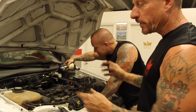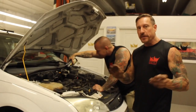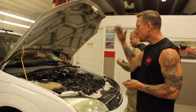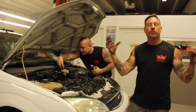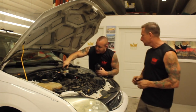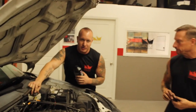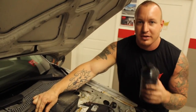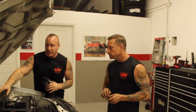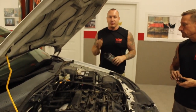Now that we've got everything assembled on the front drive axles — the brakes, the calipers, the new hoses — the next step is to bleed your brake system. What we did is we opened the brake bleeders on the back of the calipers and did what we call a gravity bleed. This simply means that brake fluid from the brake fluid reservoir ran down through the calipers and preliminarily set them up to make the bleeding process a little easier. Since we did open up the lines on this hydraulic brake system, we naturally lose fluid from it — also the loss of fluid from the old calipers and now an empty new one. So we have to gravity bleed to fill up all those air pockets with fluid, install new fluid in the master cylinder reservoir, and continue to top it up.